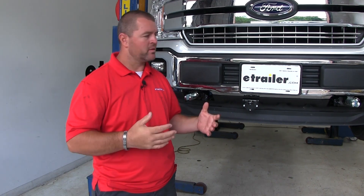As far as the installation goes, it is a pretty simple installation. You will need a light tester to figure out which wires are your brake wire, running lights, and turn signals. Other than that, all you're doing is splicing wires and running a wire from the back to the front.